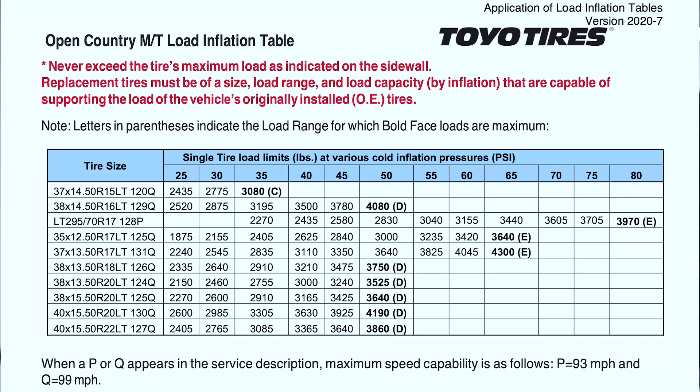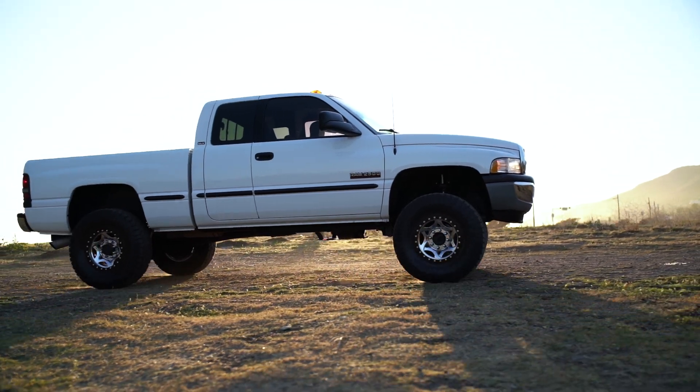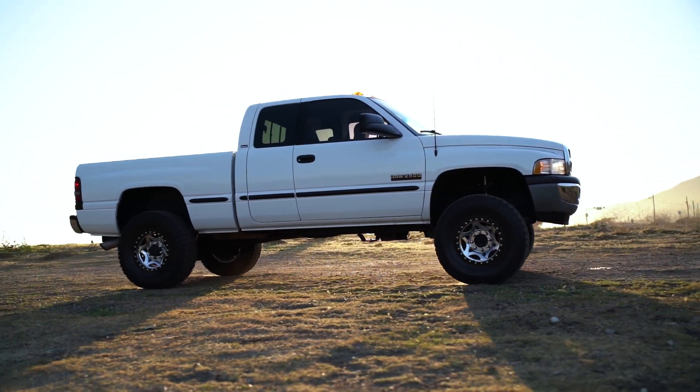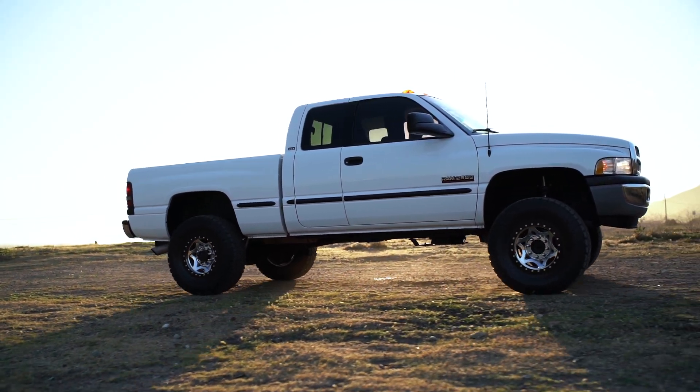Using this chart, you're going to assume the front axle weight and rear axle weight of your truck, then divide by two so you know what's on each tire. Ideally you would take your truck to a scale and weigh it — unloaded and loaded — so you know what your pressure should be with the typical trailer you pull. But most of us don't have a scale. So what I'm going to show you next is how to figure out tire pressure without a scale.